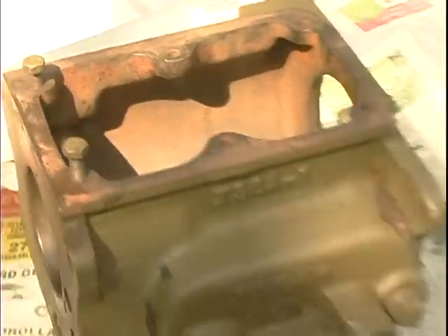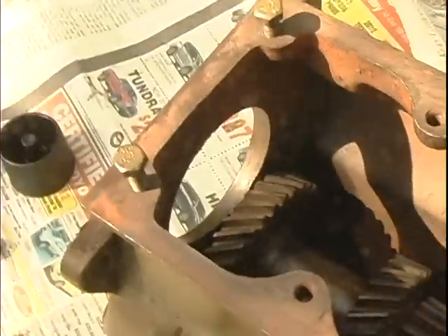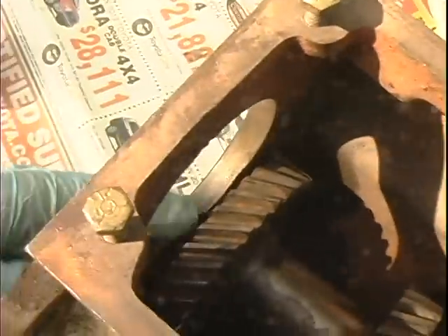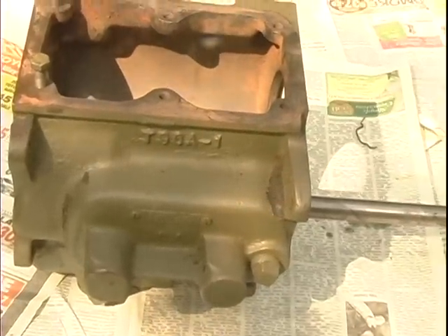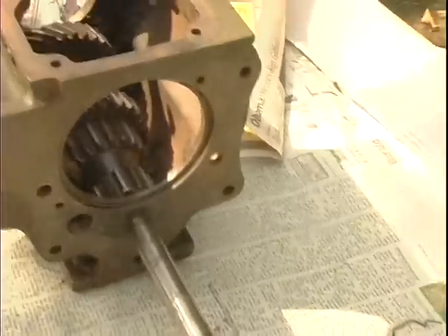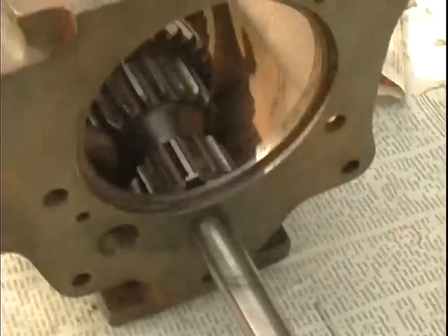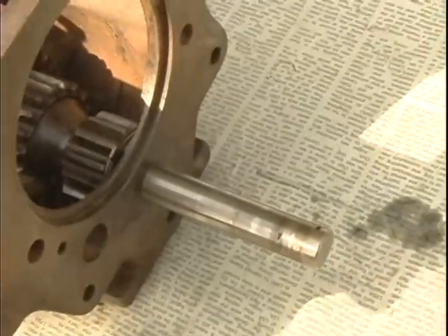Now I've got the transmission back on the workbench. I've got the pin started — it's just kind of sitting there right now and the dowel pin is still inside. One thing that'll get you: on the big washer on the inside there's a slot that it goes into. If the washer indent is not in that slot, it'll put too much pressure on the other side and you can't get the second washers in. We're all set — ready to go to the next step of working on this Spicer T90A-1 transmission in a 1953 M38A1 Jeep. It's easy to get the rod in because the dowel pin is inside — it just works its way right on back in. On the other side, the dowel pin comes out, and that's all there is to it.